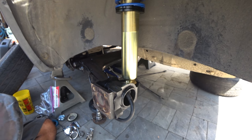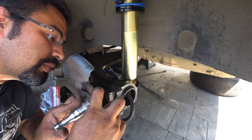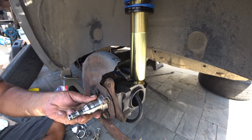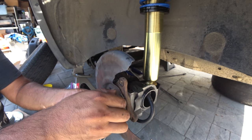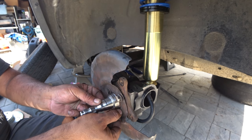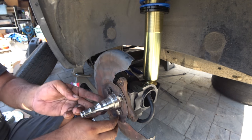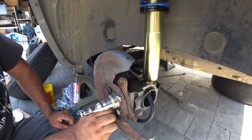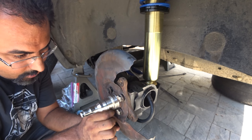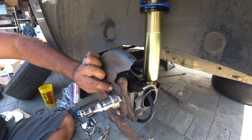Alright, so after doing some research online, actually in the US, depending on which version of the Mark II, the dust covers were actually installed backwards, as you guys can see here. Going online, there's actually a couple ways of mounting this. Since this one has a disc brake, these dust covers actually don't fit if you put them the other way. And these are OEM, guys. I actually had these on, I have all the original paperwork to this car. So that's really odd that they are installed this way. But that's just how it goes.